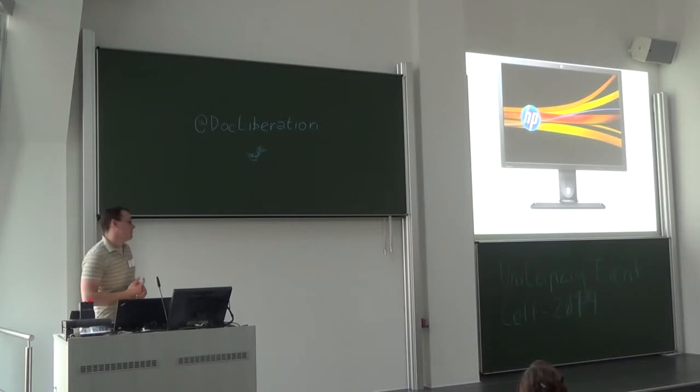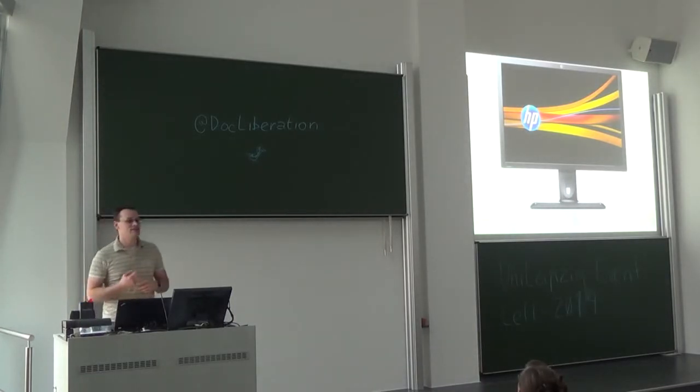And then something happened. Display manufacturers began selling displays that could display many more colours, much deeper blues, much more vivid reds, much more natural greens. But in doing so, they changed the phosphors they were using. This was going to happen anyway with the shift to TFT and then LED, but it's happened much more quickly. Now displays you can get in the shop are much, much better in terms of colour gamut than you could have got with a CRT monitor. So the upgraded screen technology drives us to do something slightly different.